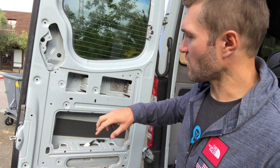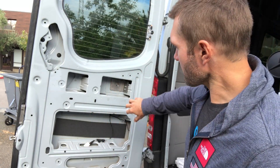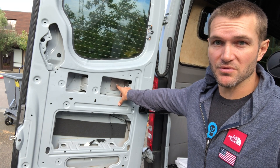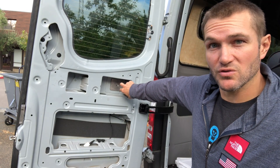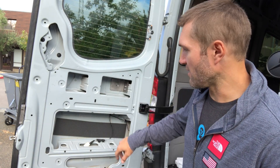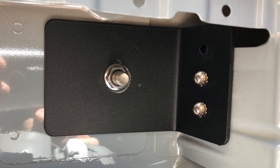We include some sheet metal screws. Those sheet metal screws are for creating pilot holes for setting the bigger bolts. First you've got this hole it's got to line up with — I like to stick one of the bolts through there just to make sure it stays lined up. Once you get that through, you can put the two pilot sheet metal screws through the door, then back those sheet metal screws out, take the whole thing off, and you're going to want to drill out — I use a step bit to widen those holes slightly.